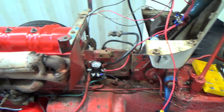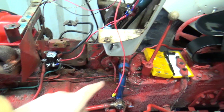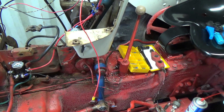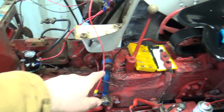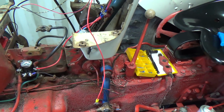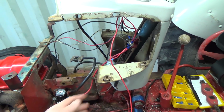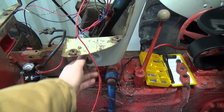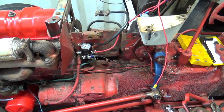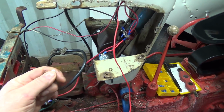Okay, some mysteries are starting to unravel themselves here a little bit. I kind of figured out why they weren't using that push button, because it's not working. I did some continuity testing on there, grounded out to the frame, and then to the little tab there, push the button, and nothing. So that button's junk. That's why they had it set up with the key switch, as in, on, and then on. So I'm still going to test her, because I'll probably order a new key switch for it and get it in about 6 years and then put her on.